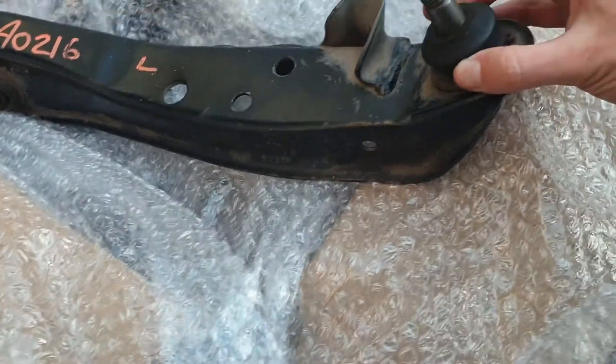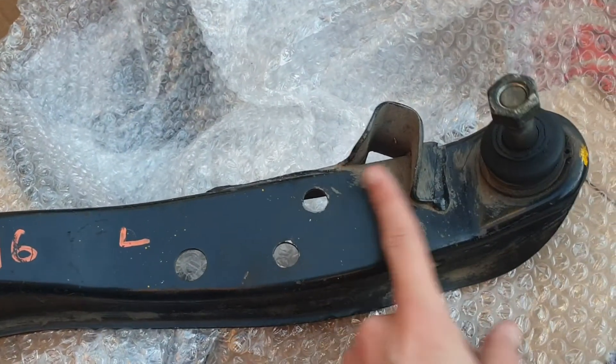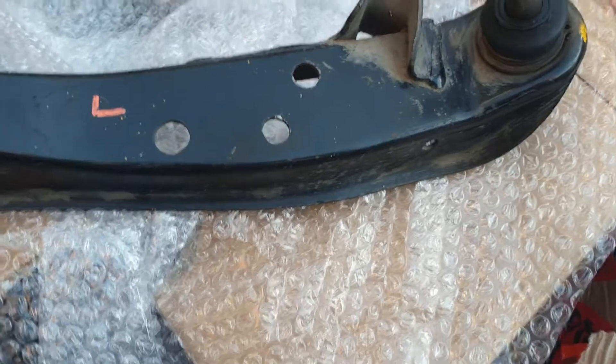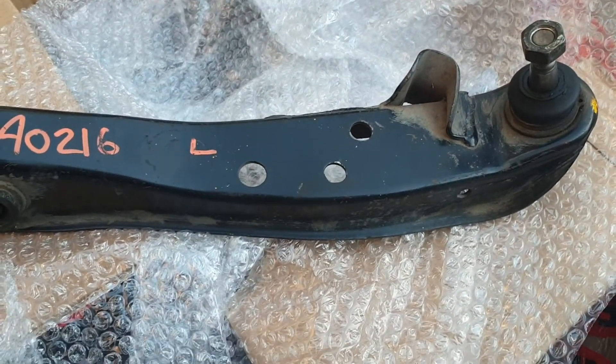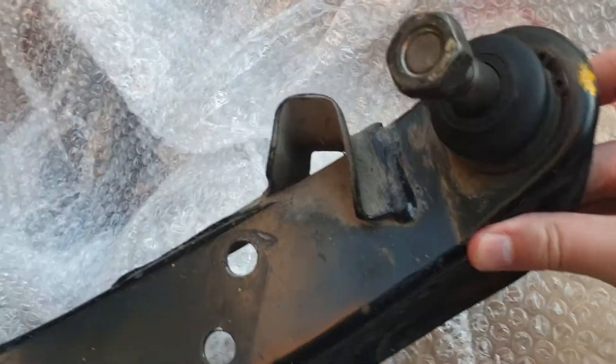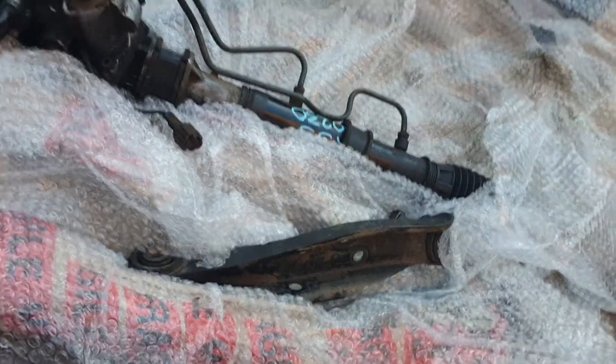What we've got here is excellent — that's in pretty decent nick, exciting. Okay, lower control arm. The ones currently in the car are chopped — they've been cut here and extended by about two centimeters, which gives you better steering angle and extends the wheelbase a bit, which is cool, but it's not exactly ideal for when you're on the road. I'm looking to get new ball joints but that looks to be in pretty nice condition — I might even be able to get away with that. The other idea is to replace the lower control arm bushes. When I change them, because the current ones are extended, there are a few other things that are going to have to change along with it. So that's front suspension.